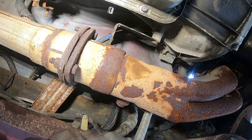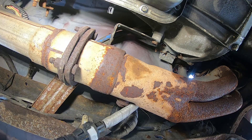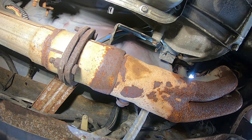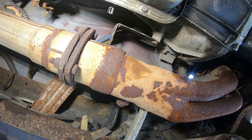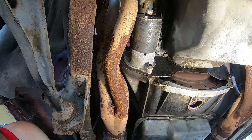I'm surprised this truck ran. The connection on top I can't get to right now — I'm going to have to lower the back end and try to unplug it, it's just so wedged in there. Let's pull the dipstick tube and then pull the starter. Let's rotate to the other side and take the starter off.